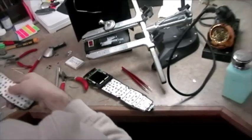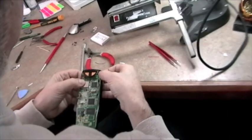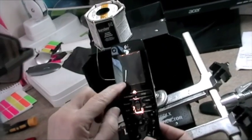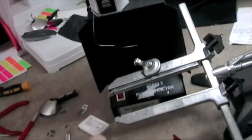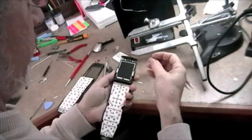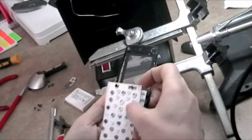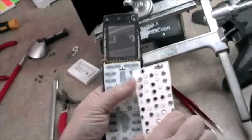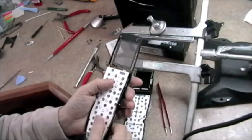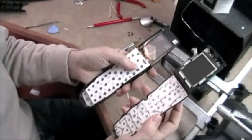Now I'm going to place this in the front cover just to do an alignment check and make sure everything looks good. I see a little bit of silver at the bottom, a little bit of silver at the top, and those lines look pretty parallel — so I think we're good to go. I'm going to remove the tape. Make sure that this guide pad is on correctly — this rectangular guide should be on the right. If it's on the left, it's upside down. Sometimes these things can be put in backwards if you cleaned it and forgot how it went in.